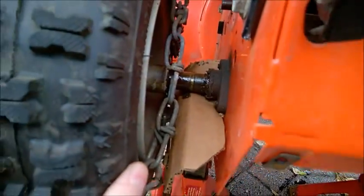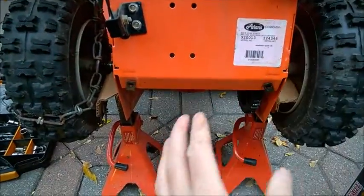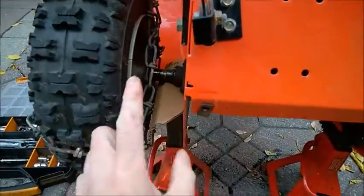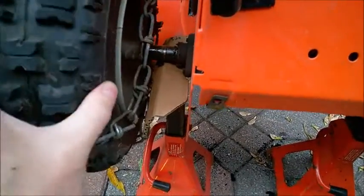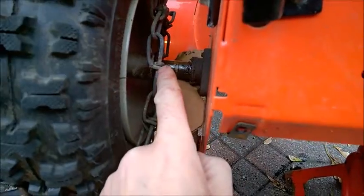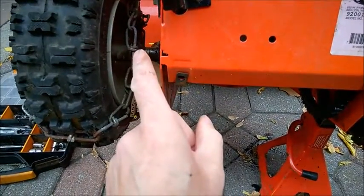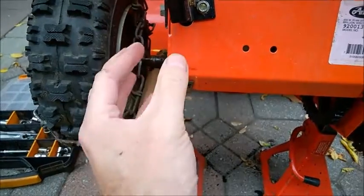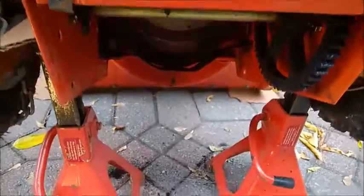These wheels get stuck completely on the axle shaft, and sometimes you need to replace the wheel friction disc. They get stuck after one or two years and it's almost impossible to remove them because there is no lubrication from the factory. That's most important — use a very high quality grease on that part. The cheap mineral grease will just get them stuck one or two years later.